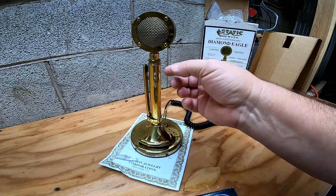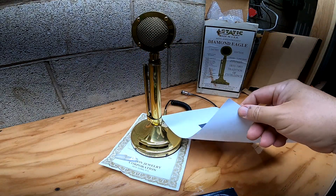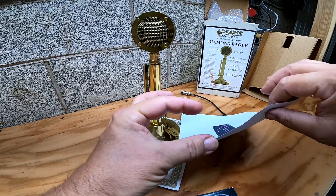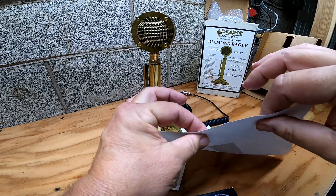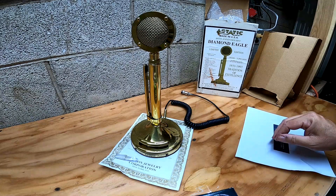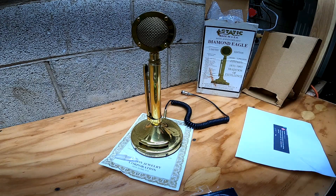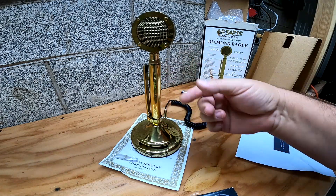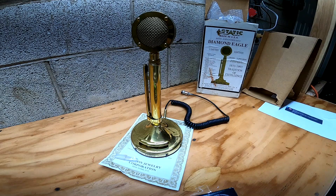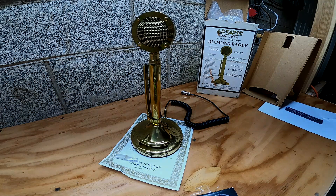You can also pull the stock out, undo the head, and maybe run a matchbook or some rough printer paper — fold it over a few times and run that between the contacts. You have a contact here and here, and you take the paper and go like that. You're not going to want to use emery cloth or sandpaper — you want rough printer paper, or if you have some old school matchbooks, do something like that. Thanks for watching, guys. Just don't pay too much for them. Watch for the pitting issues, and y'all have yourselves a super fine one. Thanks for your support. If you have any questions or comments, please leave them down below, and don't forget to subscribe. Cheers, everybody.